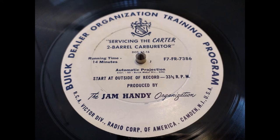The accelerating pump rod is now on the choke housing side of the carburetor. However, the choke rod and the fast idle cam are in the same location as on the previous model. Another new feature of the Carter carburetor is the start aid torsion spring on the throttle lever. This improvement of an exclusive Buick feature is designed to prevent unintentional choke unloading during initial cold starts.